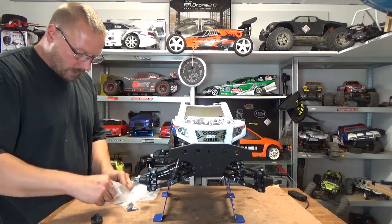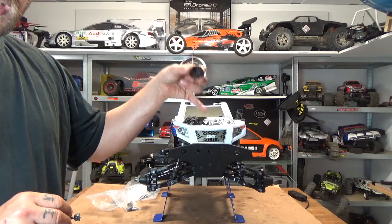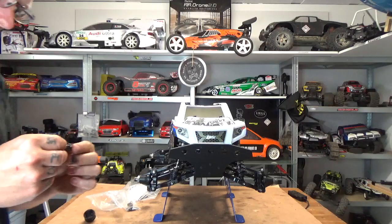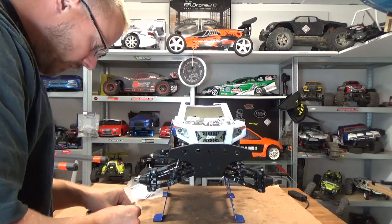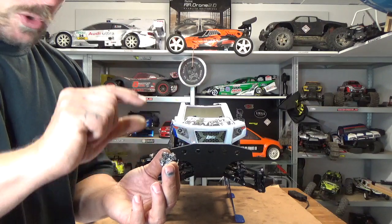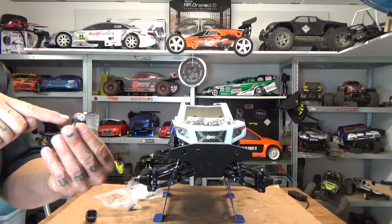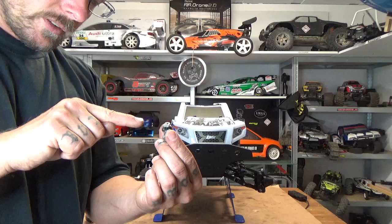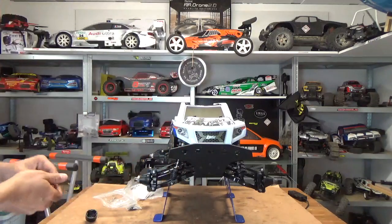What I do here is use an LSD differential from the center — I buy the repair kit from the LSD center differential and put it in the front. On the stock differential the two axles form a cross in the middle; on the LSD differential, instead of a cross you have a square. The diff output shaft sits just before it, so when I have compression from both sides I hope the diff output cannot push the planetary onto the satellite to destroy it — it touches the square in the middle and stops.